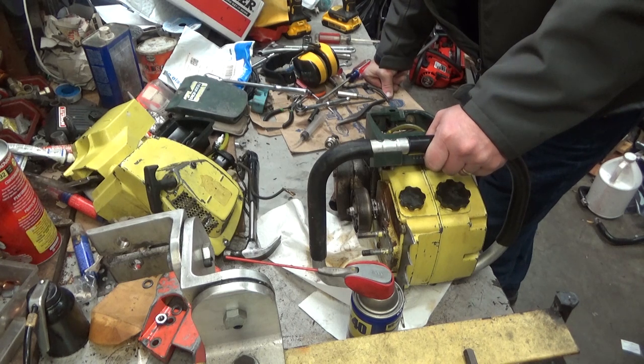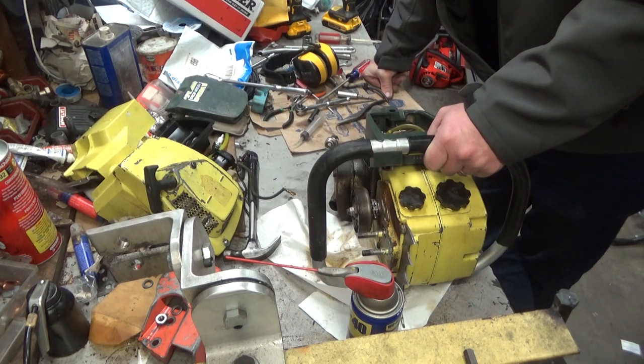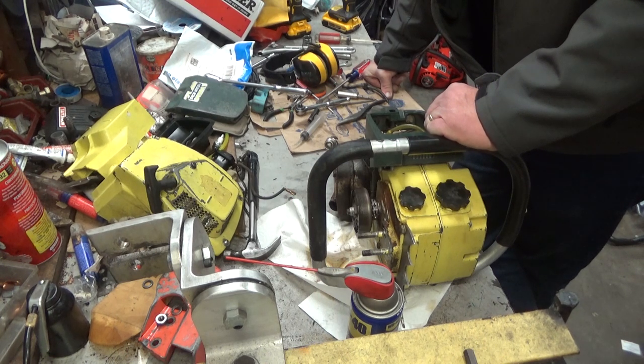But I know that Homelite offered Phelon and Wico ignition systems, both in points and in electronic ignition at one point or another. You couldn't mix those things because the flywheel magnet polarity was reversed between the two. So you might be able to get a spark, but it'd be a thready little pile of crap like the first one with just the spark plug. And the timing was off. So, I am assuming that that's what's wrong with this saw. I'm going to assume that there's a flywheel on here that was meant for a points ignition, or that the flywheel has been hit super hard at some point when someone was trying to remove it, and it's damaged the magnetic field of the flywheel.